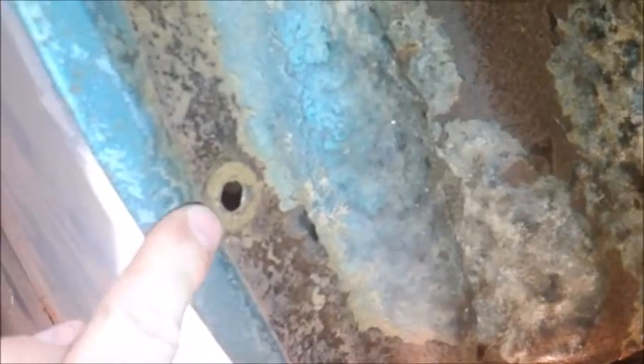There's one up front, right in front of this area under the front fender toward the bumper side, and there's also these two — this one here on the bottom and this one here — that were pretty much rusted solid. This bolt is actually going into a clip which had come loose of the actual bracket assembly, so it was just in there kind of free spinning. On the underside of the fender you can actually get a wrench on there — I tried channel locks but they didn't work as well as a wrench did once I got it in the right position.